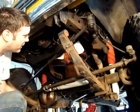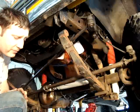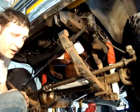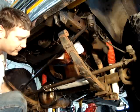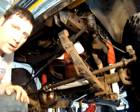So now we're just going to snug that down and our straight steer brace is installed. It takes about 15 minutes, so it's one of the nicest things you can do to a Scout. It'll eliminate about 90% of the twisting on the frame rail that cracks the frame rail behind the steering box because of the bump steer. Thank you very much for another video from Backcountry Binders 4x4.